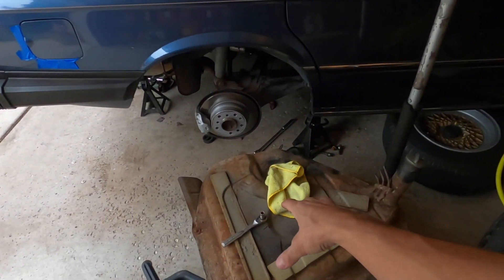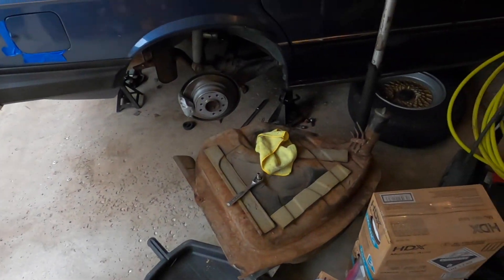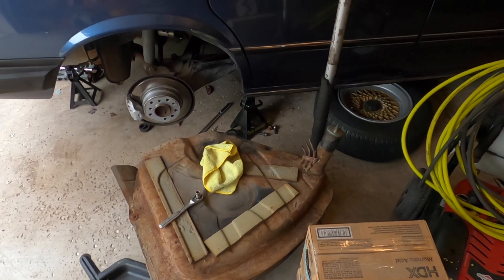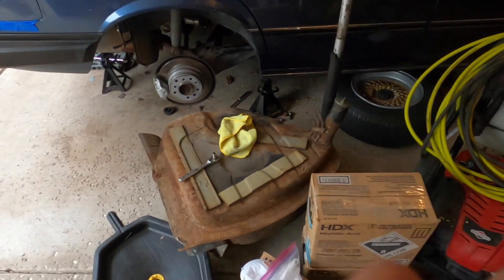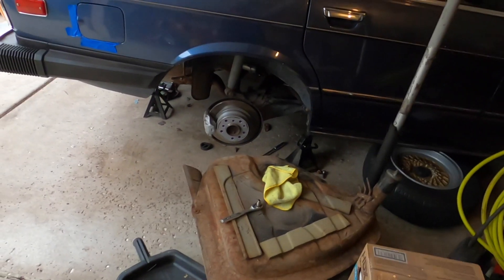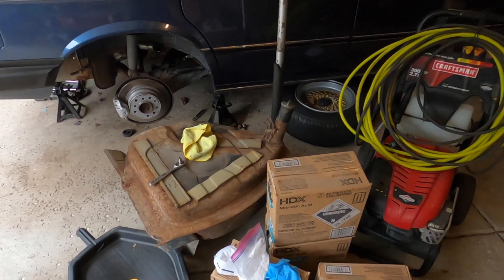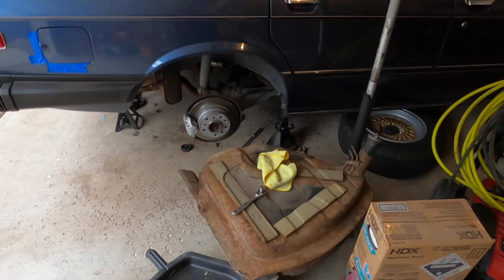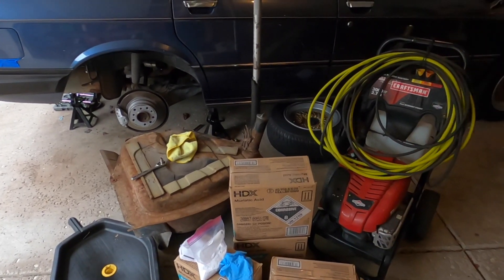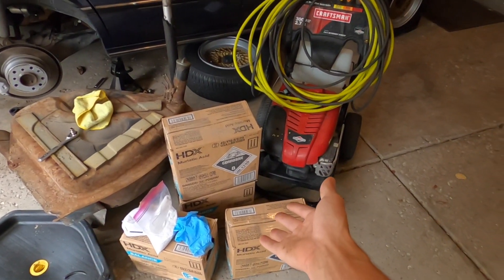The plan of attack: first I've got to get the gas still in the tank out. I'm going to dump it in the catch basin rather than in the yard. Then I'll pressure wash the inside of the tank and flush all the loose stuff out — all the loose sediment at the bottom is my biggest problem. After that, I'll pour half a tank of water and then half a tank of muriatic acid, mixed one to one.